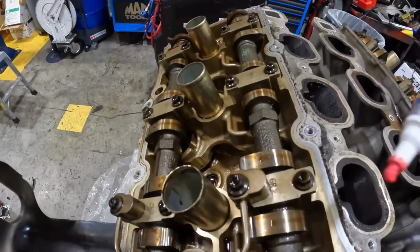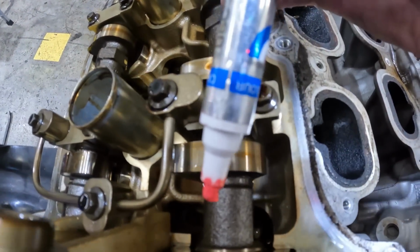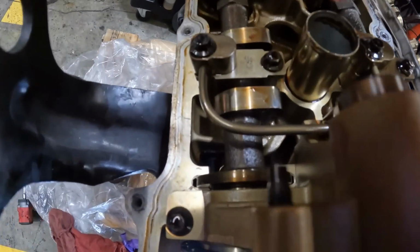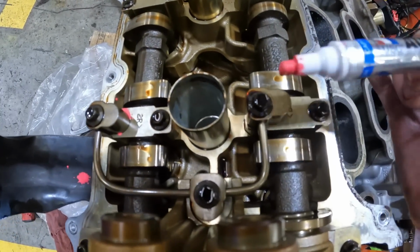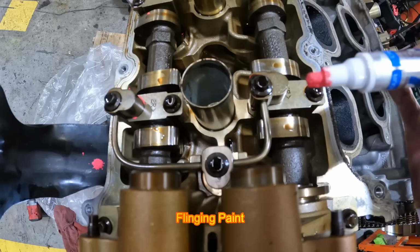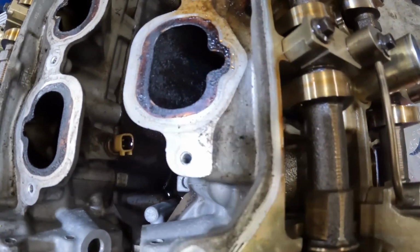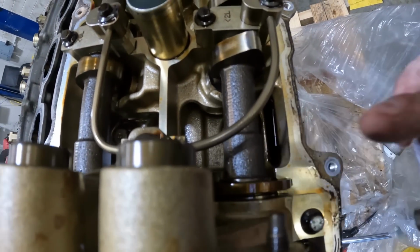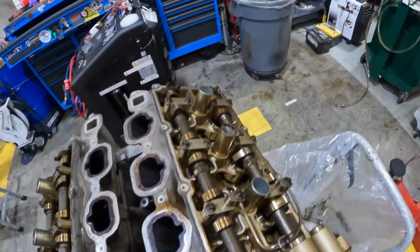And see how you got a flat side. Obviously, this oil tube will have to come out. You have flat side. Cam lobes facing in, cam lobes facing in. This is cylinder one, number one. This is in top dead center. You have flat side. That allows me to put the holder down in there to hold the cams in place.